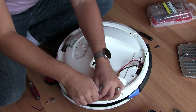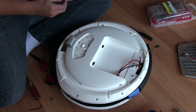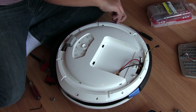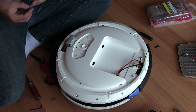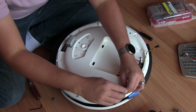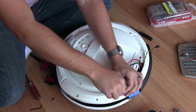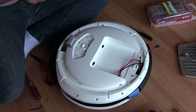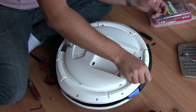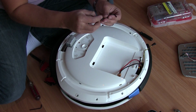I'm just checking there. It's actually nice to hopefully have a tube now to fill up every single time I go out, because that wasn't too fun. And towards the end, I'm guessing it just got worse. So I would ride for 20 minutes or so and I'd have like 20 pounds of air left. And then the riding characteristics change dramatically as that tube starts to get more and more deflated. So you weren't really getting the proper experience that way. You know, if you're setting out at 50 PSI, you want to come home at 50 PSI.